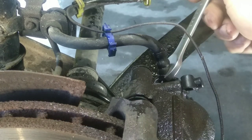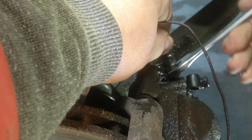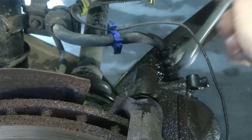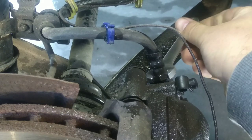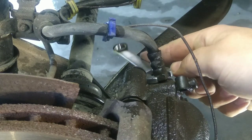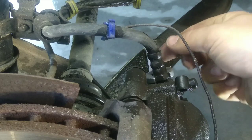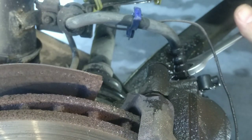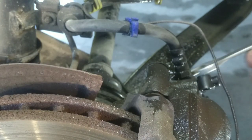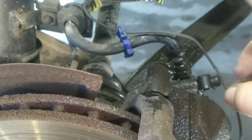This is a 14mm fitting; upstairs it's 17mm and 15mm. What you want to see is oil coming out of the fitting as you loosen it — I can see it dripping into the pan. This actually means I need to replace my flexible brake hose; it is a bit clogged. But it runs okay for now. The last and almost most important step is coming up.